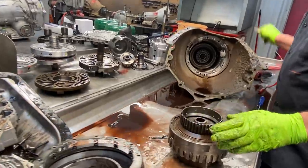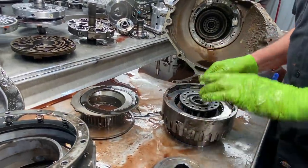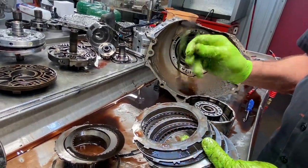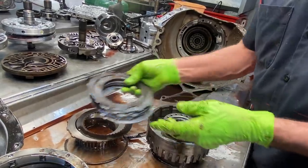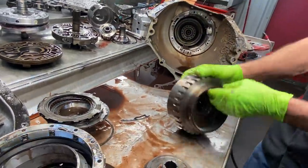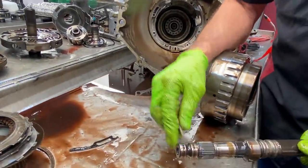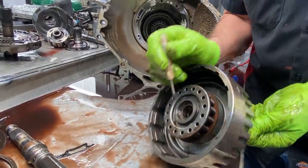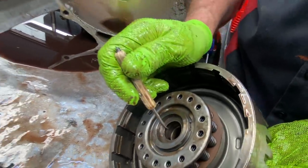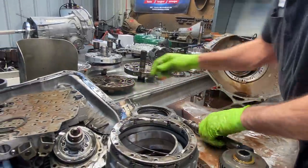We have our forward drum here — you can see we still have a wave in the forward drum, which we'll be leaving in there. We'll be putting a new bonded piston, new clutches, and cleaning the steels up. But you always want to check right here — if this bushing gets worn out, it lets the input shaft and these two sealing rings cause the shaft to start rubbing on the inside of this drum. You can see it hasn't rubbed at all, so the bushing is still good, but we'll replace it. We get them in 100% of the time where this shaft has been rubbing and causes the forward clutch to burn up.